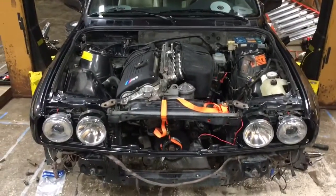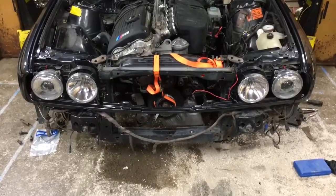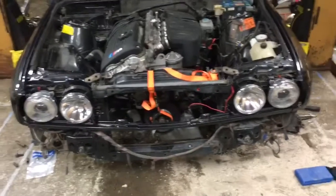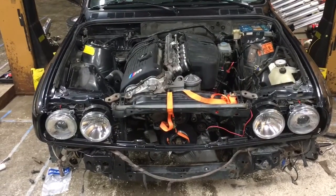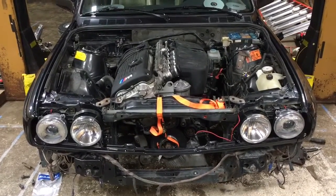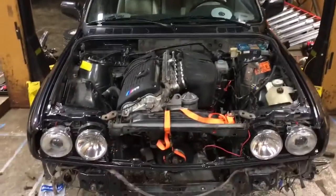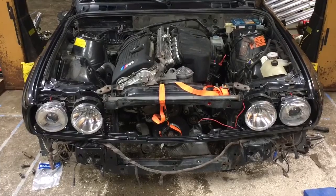The S54 is sitting bolted down on the engine mounts and I'll have the ZF trans back in it real soon. I'll start bolting it together mechanically and then deal with the brakes after that. One of the last things I'll do is make and go over the adapter wiring harness you need to connect the MSS54 to the E30 chassis. You do need to have your computer coded to make it run on a swap like this - you can't just plug it in and have it work. Once the EWS is removed it's not too bad, but it costs quite a bit and you have to send your computer out. The old S52 is hopefully going away tomorrow to a new home in an E36 running at Circuit of the Americas.